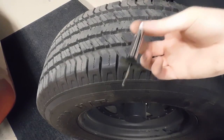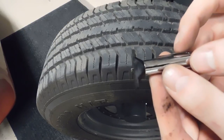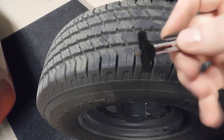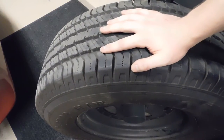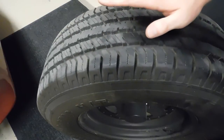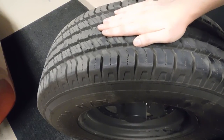It's really nice to have and easy to use. If your vehicle only has 2/32 of an inch worth of tread, that is very dangerous so make sure you have a good amount. But just because you have a good amount of tread does not mean your tire is good - you also need to inspect the sidewalls to make sure they're in good condition. Check that the wear across your tire is not uneven; you don't want more wear in the center or more wear on the outside.